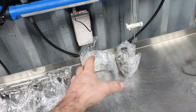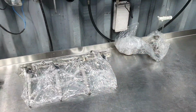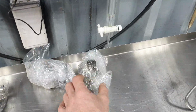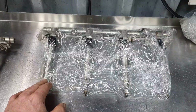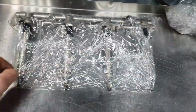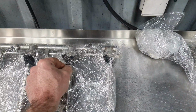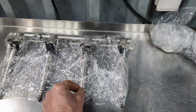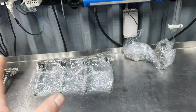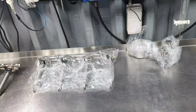Understood? For the high pressure pumps, it's much simpler, because if it has a single scoring inside, you're going to reduce the performance of the pump too much. You're going to see it clearly. And again, if there is a problem, let us say with a high pressure pump, you're going to be lean on the whole bank. The oxygen sensor will show you there is a problem, because you're not going to lean out only one cylinder, you're going to lean out the whole bank. So you're going to go to fail safe. From fuel starvation of the fuel pump, you might get away. Fuel starvation from a single injector, you're not going to get away. Like I said, with the small difference when you're at the limit, when you have, let us say, all the cylinders at 12:1 air-fuel ratio and then one cylinder running 16:1, there you're going to see the results.